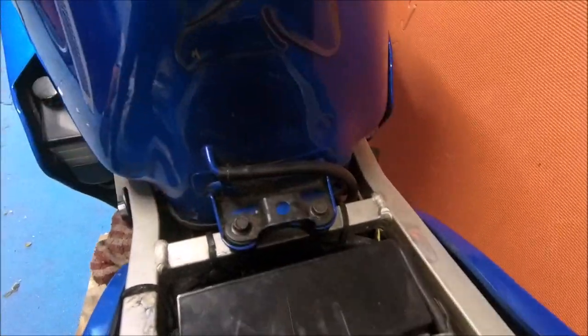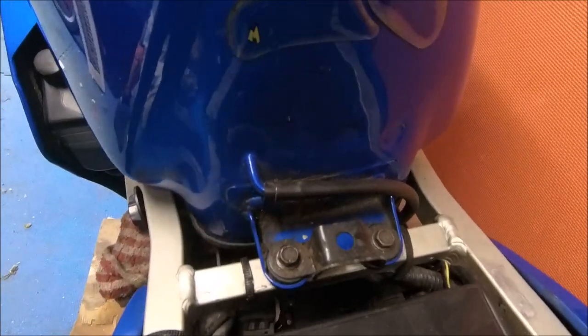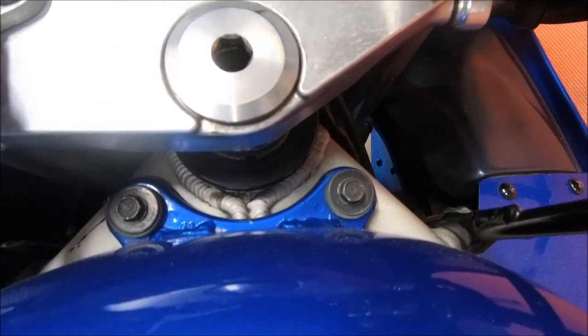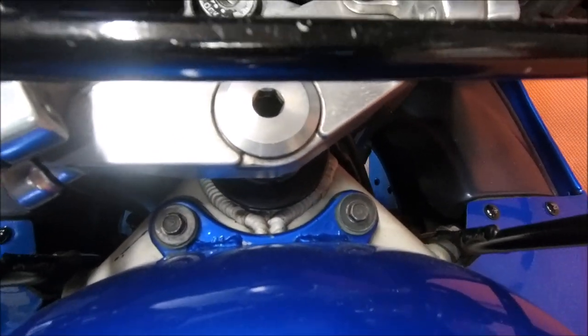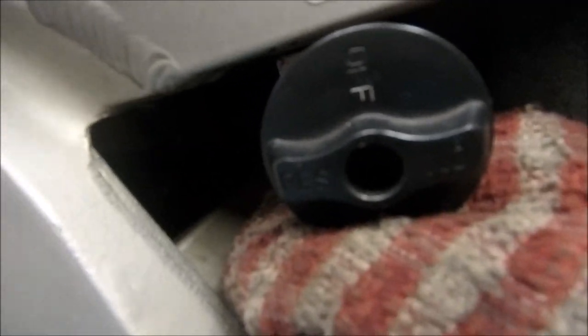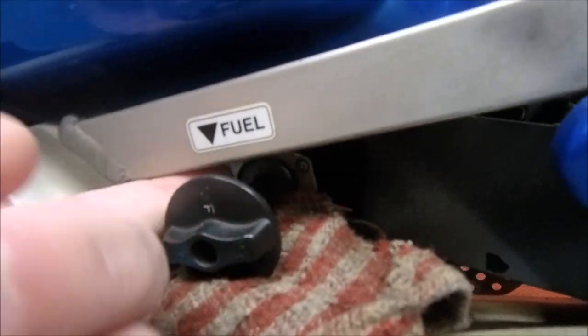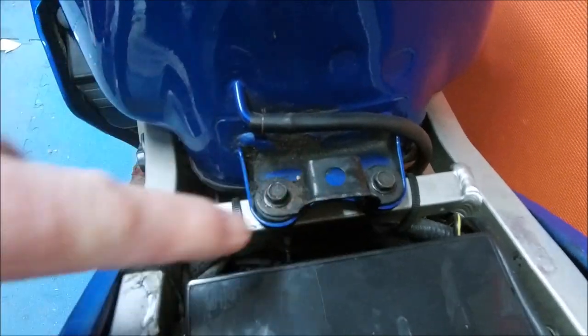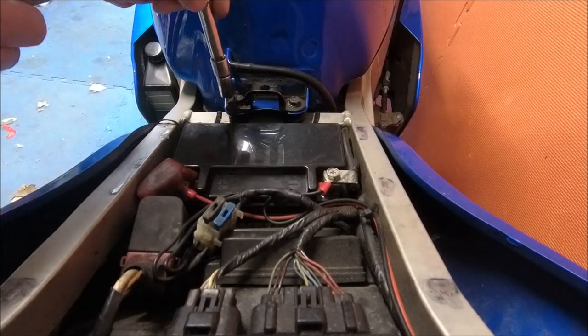Next job — I can leave that overflow pipe on, it just pokes down near the frame for any expansion. Two bolts there, two up there — all 10mm I believe, could be 12 though, I'll let you know. Also have to take off the fuel tap — there's a screw in the middle there, you can't really see it, but there's a screw in the middle because it'll hit the frame if you try to pull the tank off. Fuel tap off — four bolts — make sure you keep that bracket in the orientation it's in at the moment because that's where your seat slides in.